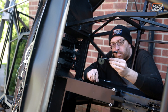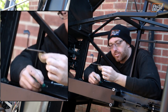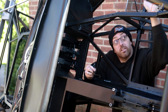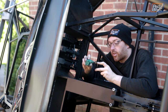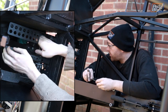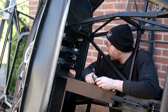I've put together this slightly Heath Robinson little bracket out of a large M10 washer which will sit over the balance bar and move backwards and forwards as the pedal runs, but that will also transition us with 15mm of movement up to this point. It's a little bit of 4mm rod that goes onto a piece of the same 10mm tubing we used for the framework outside on the car. The switch fits into the end of that and locates it nicely so it can't fall off, so we can now get this pushing back really neatly. We've quickly tried it before I painted it up and it does seem to work, so we'll show you how it all fits together and try to make it actuate.